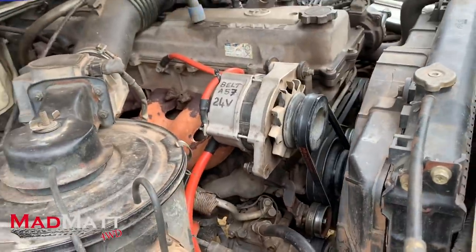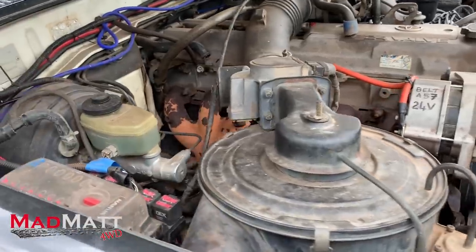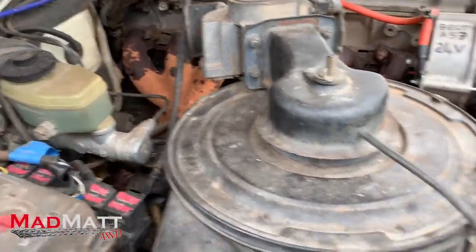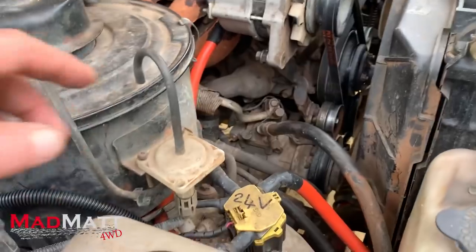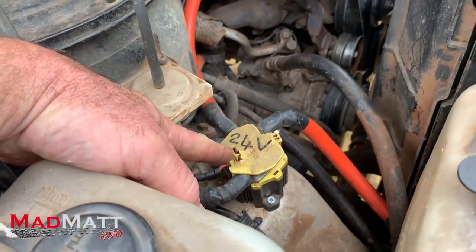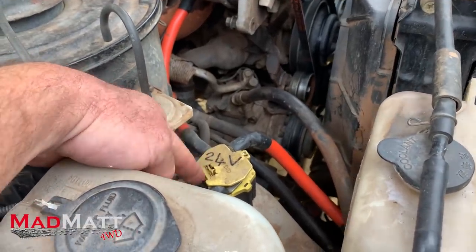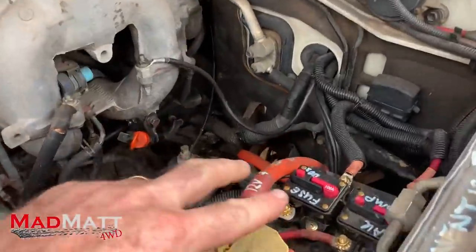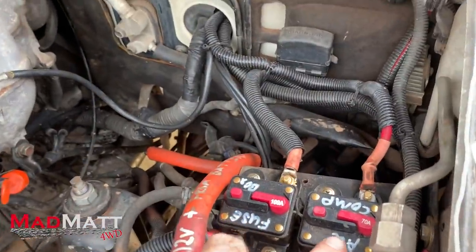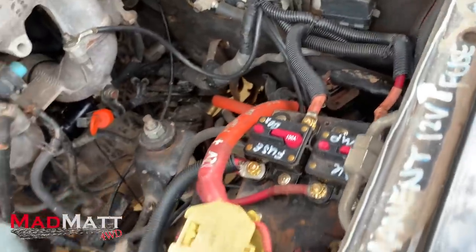I make a bit of a joke about running air conditioning, but the reason I'm running it is last year at Cliffhanger I got heat stroke because you're in a race suit running around like a pork chop. So I thought I'd leave the air conditioning in so we can manage our fatigue. This is an isolator — the vehicle has to have isolation systems so that when you flick a master switch, everything isolates. This isolates the 24-volt system, and over this side we're isolating the 12-volt system. Then we have two circuit breakers — one for the two air compressors and one for the fuse box which drives lights and stuff.